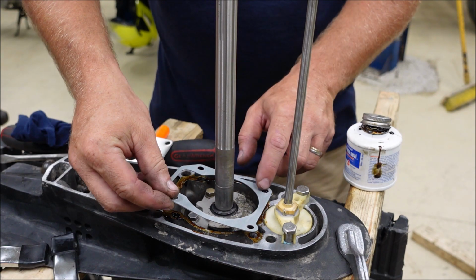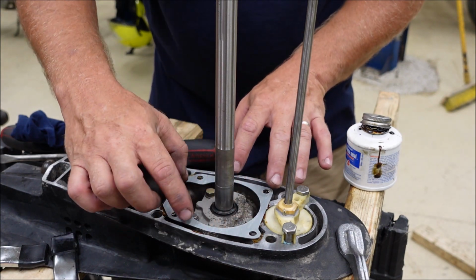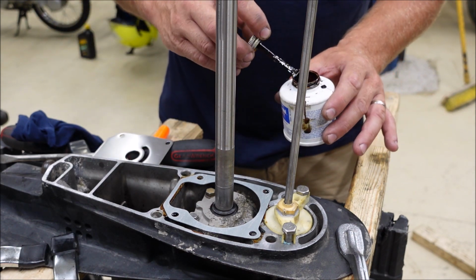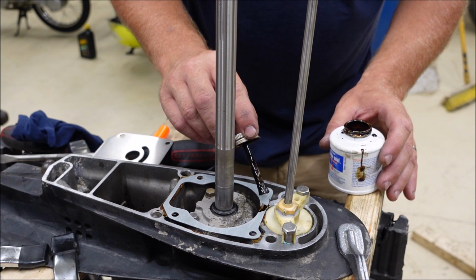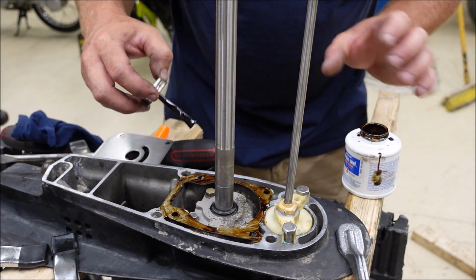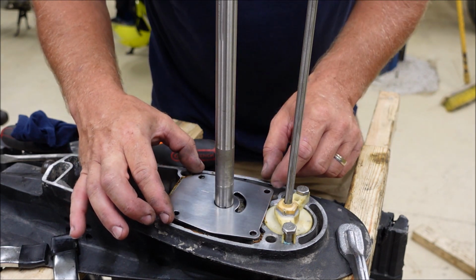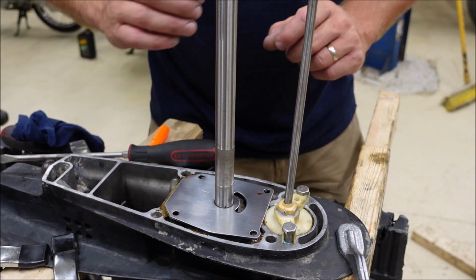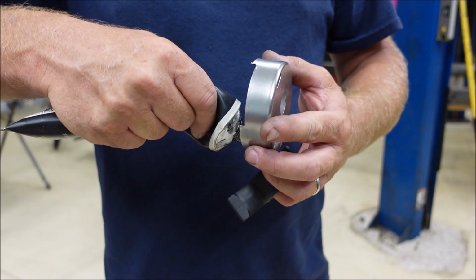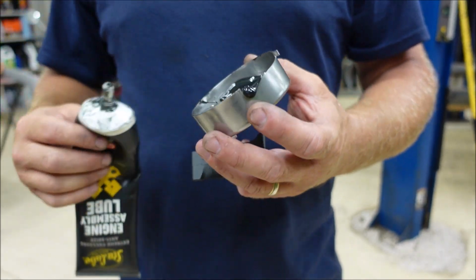First, our gasket here. I just wanted to smear on a little stickum. Seems like a good quality gasket to me too, though. Now the plate. Nice new plate. Need to put our impeller inside of this housing. This is assembly lube. It shouldn't hurt the rubber.